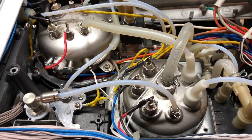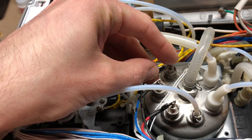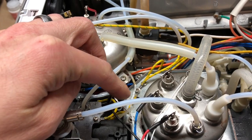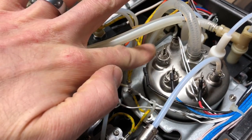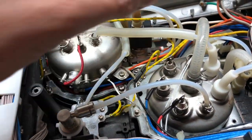I'm going to go over just how to get in there — it's really quite straightforward. You've got to remove the lugs. I'm going to use this one as an example — you just pull it off. It's going to be harder to pull off than that; I already loosened this one, but you can pull it off with your fingers. I wouldn't get in there with pliers for that. Now what you have to do is get this little U-clip that Breville uses out. You've got to pull that out — I'm going to go over that with the pliers, which you will require to pull it out. Then you can just pull the probe straight up.